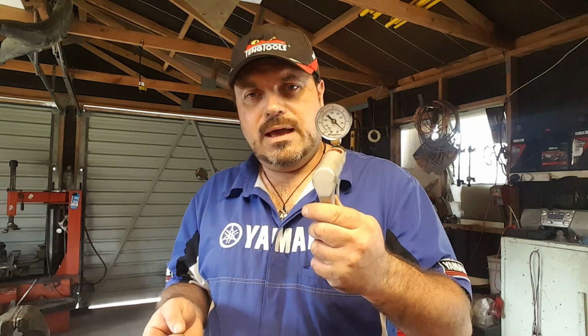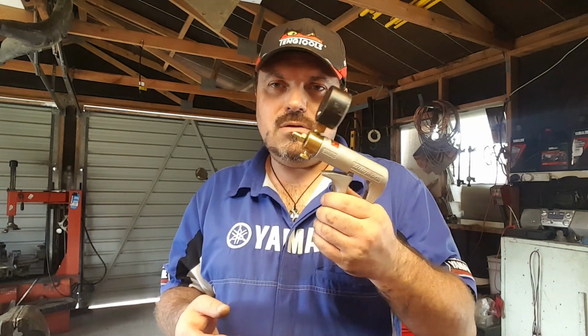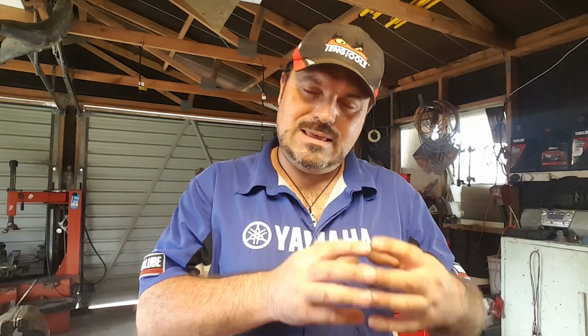And when it's on car, we just leave it plugged in on the electrics and we just back probe on the signal wire, and we use our trusty hand vacuum pump to artificially create a vacuum change, so that again we're going to see a change in voltage, hopefully. Bench testing I think is always better than on the car because it isolates the unit. We're not reliant on the wiring of the vehicle as well. We can just test that particular component on its own.